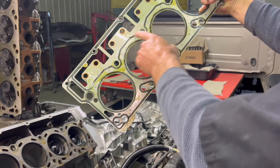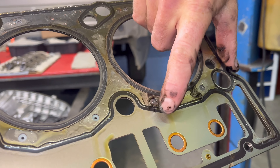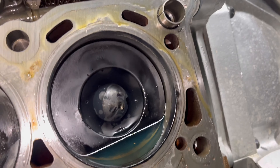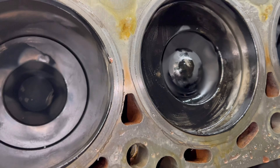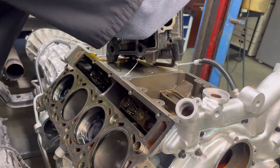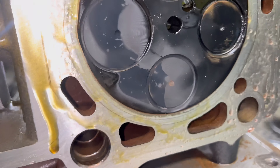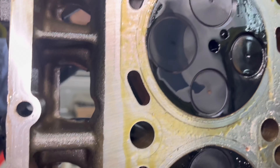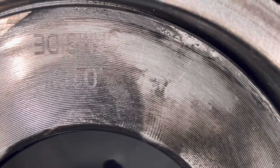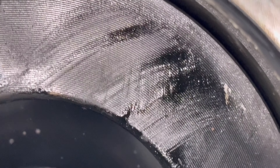What, four or five thousand mile head gasket? Look at that — the sealant came apart on the head gasket. See how I can move it? I'm sure we can reuse these head gaskets. It looks good over here. Head gasket looks good too — oh, I did cut my finger though, the side of this head is sharp. You can see the round of the valve, so that one touched a little. So did that one right there. Really no other marks anywhere — that's cylinder eight. We did wipe on it a lot.